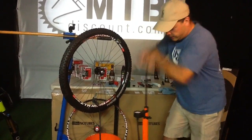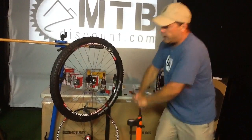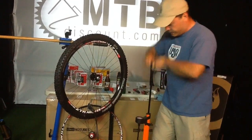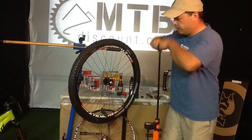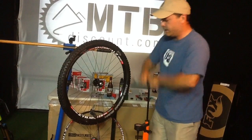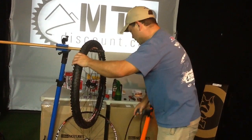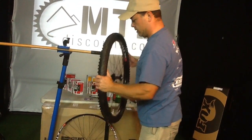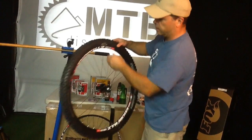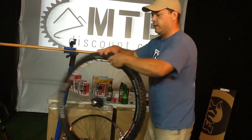Once you get this going, you're going to need to inflate it up to about 40 PSI to make sure the bead seats. You'll hear a nice little pop, usually, as it gets towards the bead — both sides. Don't want to go any higher than 40 PSI because you can blow it off the rim and damage the tire. Now that you've got it pumped up, you want to make sure you run your finger along the edge and feel that it's evenly seated all the way around, and you've got a nice bead on both sides. Then it's good to go.